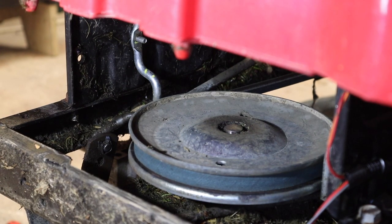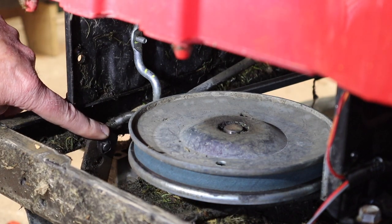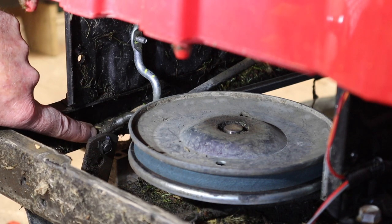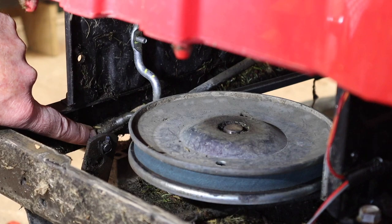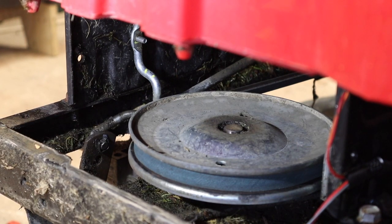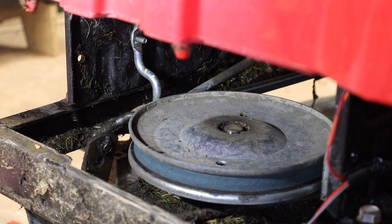Okay, hopefully you can see this now, but this is the brake lever, right? So this is the bit that goes down to the brake pads that we were looking at a minute ago, and you'll see you've got your brake bar coming in, and that connects at the top here with a kind of circlip. So basically you just pop that off, pull this out, and then you take the brakes off. And that's so that the lever comes out as one unit, so that you don't have to remove that center nut that I showed you on the other side.